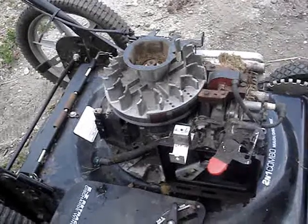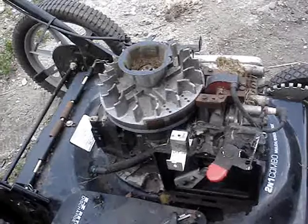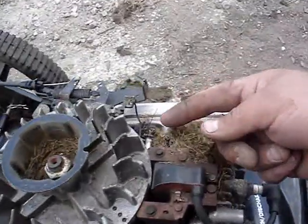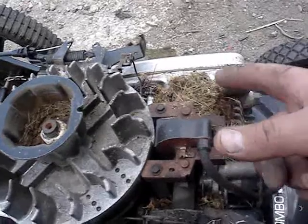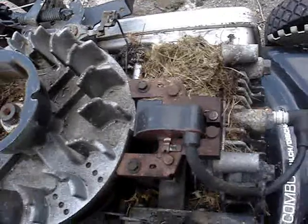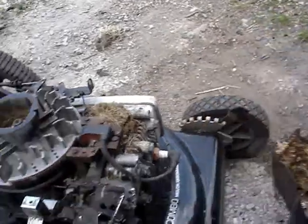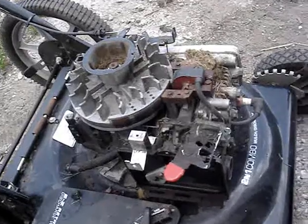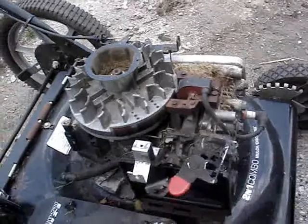The engine does run really good. At first it had a little bit of hesitation but there wasn't much gas in the tank for it to run. When I shut the engine off I noticed there was smoke coming from this side, so I decided to pop the shroud off to see if there was any gunk in there. I was amazed at what I found — pretty grassy, pretty nasty. I bet this mower was overheating because all the fins on the engine are all clogged up, so I'm gonna have to clean that up.